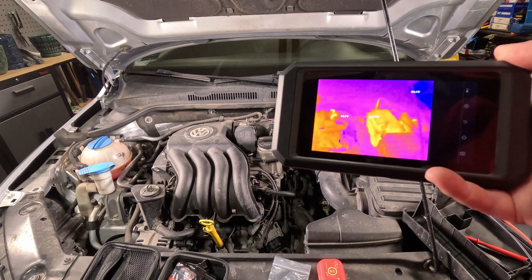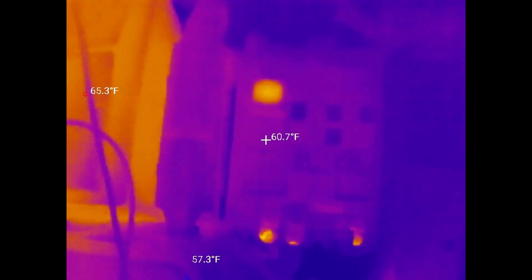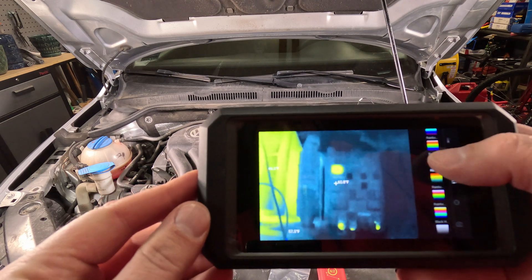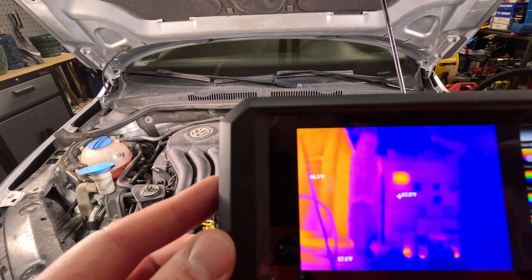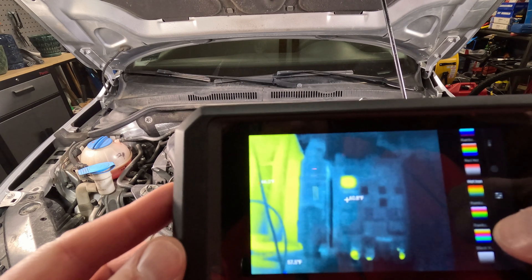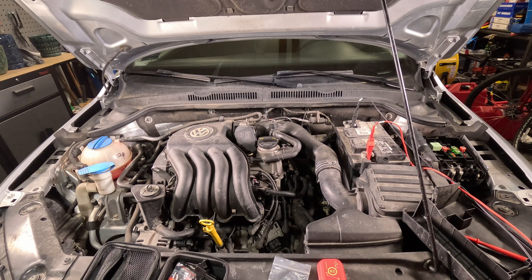We're going to go over to the battery — you can see the battery is a little bit warmer than everything else. I'm going to go over to the fuse block and we'll overlay this image on the video when we're done. We can change all of the color schemes to highlight what we want more effectively. This is the fuse block here. We have a lot of different settings we can play around with. Personally, I like the red hot scheme — it's pretty good. Otherwise the rainbow high contrast is really good too. As this vehicle sits a little bit longer, obviously the temperature is going to rise on the fuses and relays, so we're going to get better contrast.